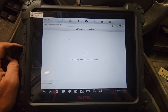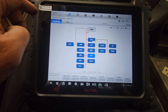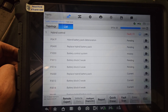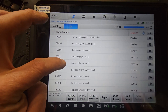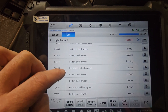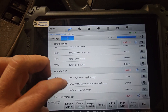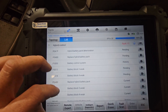Let's do an auto scan on the vehicle. After performing a scan on the hybrid control unit, I found that it has 11 faults in the control unit and it's due to a bad hybrid battery. You have a couple cells here getting weak. You might also have a brake booster problem, but I would have to replace the battery first before making any more diagnosis.